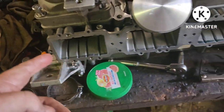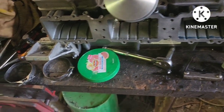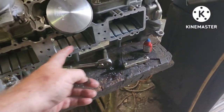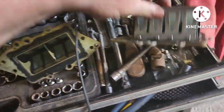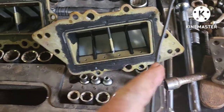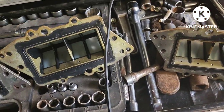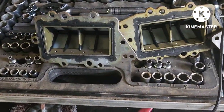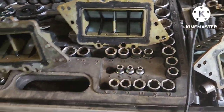There's also a special reed valve — one reed valve is different for the middle cylinder on this 1300; it's not like that on the 800s. I'm assuming the 1200 is the same way. The middle reed valve is shaped different than the other two — it has ears on both ends, whereas the other two go like this. The middle one is the only one that has the angles on both sides.